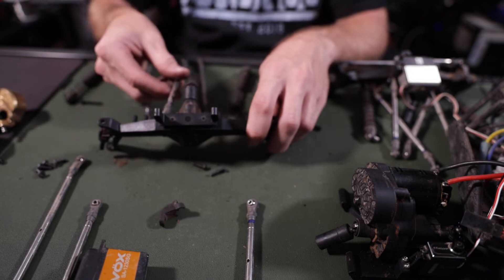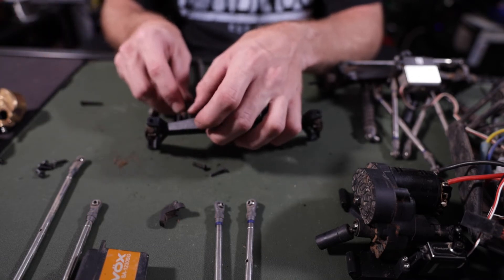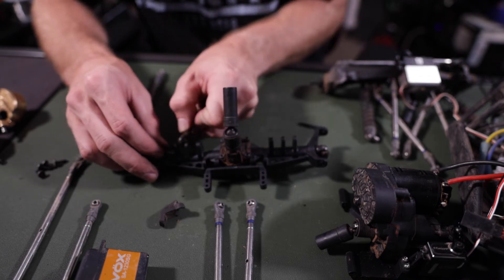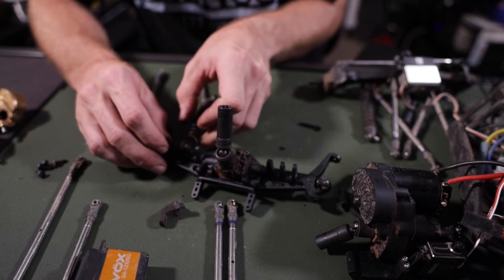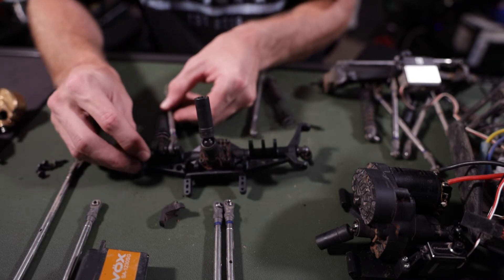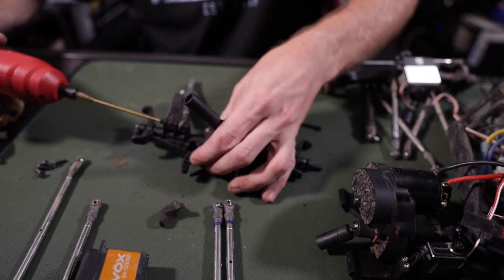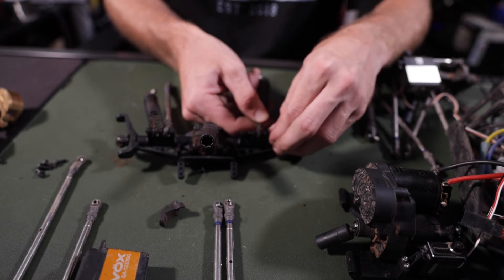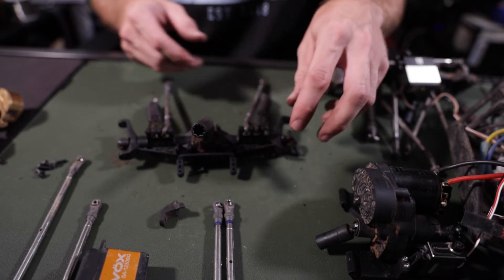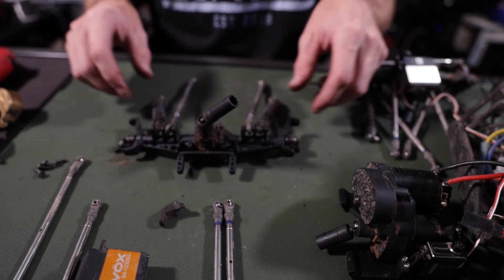The upper links only have one spot to go and are straight, so they're pretty hard to screw up. A trick I've learned for getting suspension and links back in is to use the screw to your advantage: put the screw in, thread it through the shock so the shock sits nicely, then put your link in, push the screw through the link all the way to the end, and tighten it down. This could be a good excuse to clean parts, redo suspension, and put new oil in — or if you're lazy like me, throw it all back together and keep ripping.